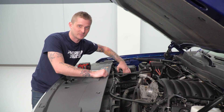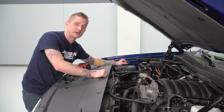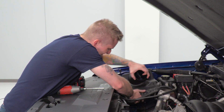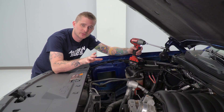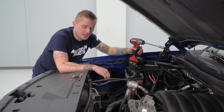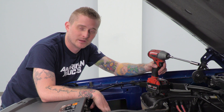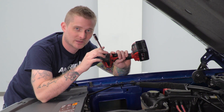Once you've pulled your tube out of the truck, you can also pull the airbox out. This is only secured by a few rubber grommets — you don't actually need any tools. All you gotta do is give it a firm tug to pop it out of that metal plate underneath, and then you can pull the box out of the truck. Now that the factory airbox is removed, we have to remove the metal mounting plate that it attaches to. There are four 10-millimeter bolts that you gotta pull out to remove the plate. If you're using a power tool, it's kind of a tight fit, so it's helpful to have an extension.